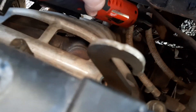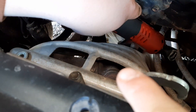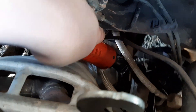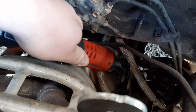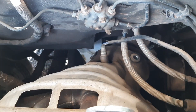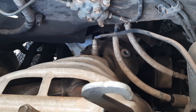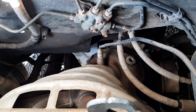Right now we are in the middle of getting off the exhaust manifold cover — right there — and it's in a tight fit. Derek's Workshop and Project is helping me today. He's done this on his car before, so he's out here helping me and I appreciate that. So we have two bolts here that we're taking out, and then two down here at the very bottom. They are 12mm bolts, by the way.